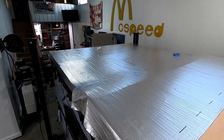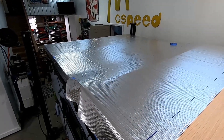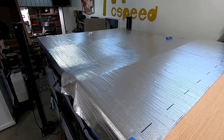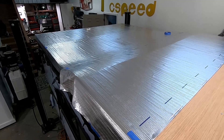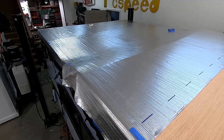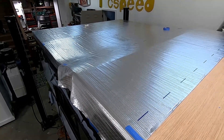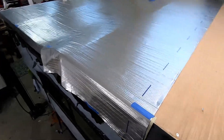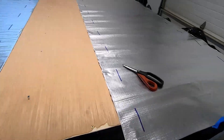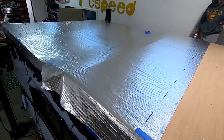It is showing 68 degrees in here, which requires 50 degrees minimum temperature. Hotter it gets, the stickier it gets. This is actually working to our advantage to not have it ultra crazy sticky at the moment. We've got to put down two more strips and then I'll start working the edges.